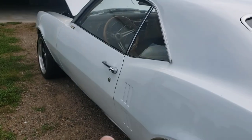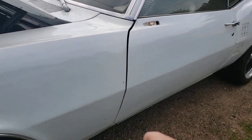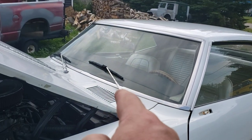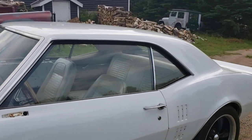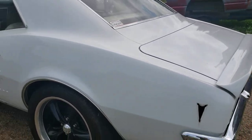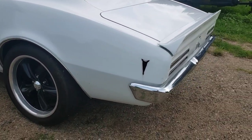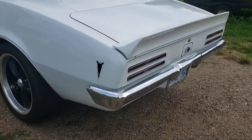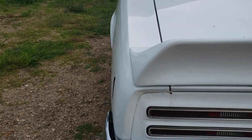If you go here, the top of the door is out and the bottom is in. The bottom at the front is about flush but here it's out, so the whole door's got to twist a bit that way. Then this fender will probably have to come out a bit — that's why we're going to move that panel over. The other fender will be slightly rotated to match the other door, which will be slightly rotated to match the rear fender. Fenders don't move once they're welded on a car — that's where they go, you've got to line everything else up. It's an original car; it saw some mini quarters down here, lower quarters. There's a little crack in the filler so we're going to clean that out. There's something going on right here — nobody knows why, might be a little ding and they just threw some filler in it and it wasn't prepped really well.